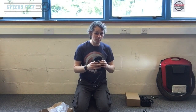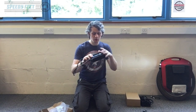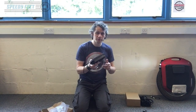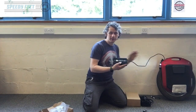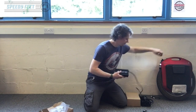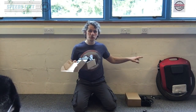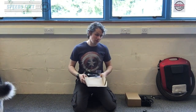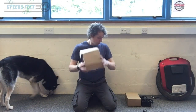You literally do no modification — just use a single charge port, plug it in, and it's 3.3 times faster than your standard charger. It has a fuse as well. We've been testing these and never had to replace it, but if you covered this in a blanket and it overheated, it would blow the fuse. You just plug it into the four-pin charge port and charge it up — job done. So that's the 5-amp version: three times the speed of charging straight into your 84-volt system.